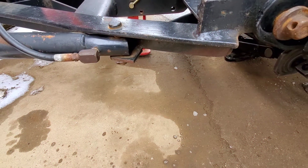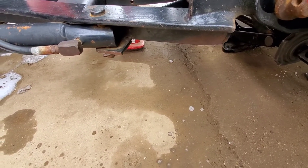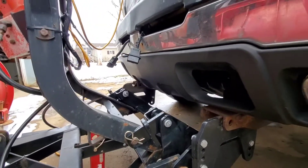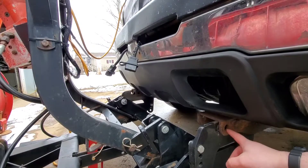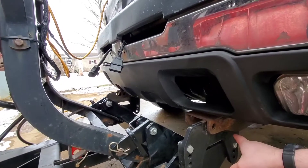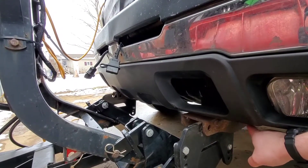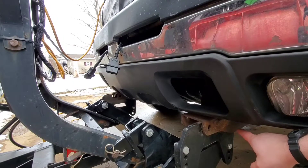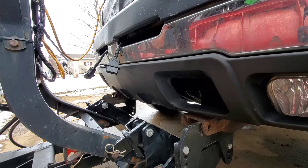What I end up doing is picking up the front of the truck along with the plow, so that way I can get that jack there about a quarter inch or so off of the ground. Then, because that tightens up the gap in here, it also angles the back part of this plate — which has the notch — that meets the back side of the Ultramount. That changes the angle just enough so those two will line up, and then I'll start the truck.